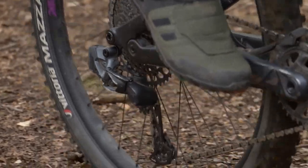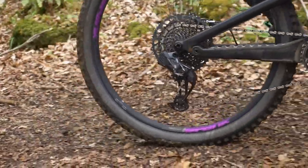There are a few things at hand here. You're never going to get good shifting if the bike isn't correct in the first place. If your mech hanger is bent, it doesn't matter if you put XTR or AXS on there — if it's not aligned, your gears are always going to play up. Your frame has to be straight or at least the hanger has to be straight. Next is your chain line — if you've got a bad chain line, maybe a bottom bracket axle that's too long, a chainring without correct offset, or an incompatible crank, your gears will play up. Make sure the derailleur is set up correctly: limit screws inner and outer, and your B screw. Make sure there's no play in the hub, because if the cassette moves around it affects gear changes.